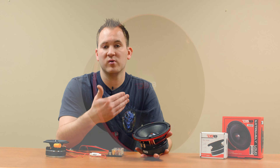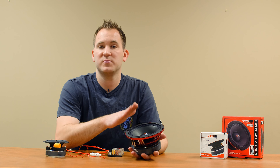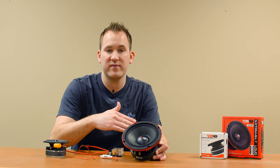On a mid-range speaker, a lot of people will buy these because they're huge — they say they handle a lot of power. They think they're going to be louder. They hook it up to their standard radio in their vehicle, which is producing the whole full range of frequency, and they blow them right away because the speaker is not designed to do so. That is when a bass blocker is installed — it goes on the positive terminal between the positive terminal and the positive speaker wire, blocking out those low frequencies so you can crank that system up. It's going to keep this speaker from moving in and out a lot because of the low frequencies, which you can tell by the surround on the speaker — it is not designed to have that high excursion.